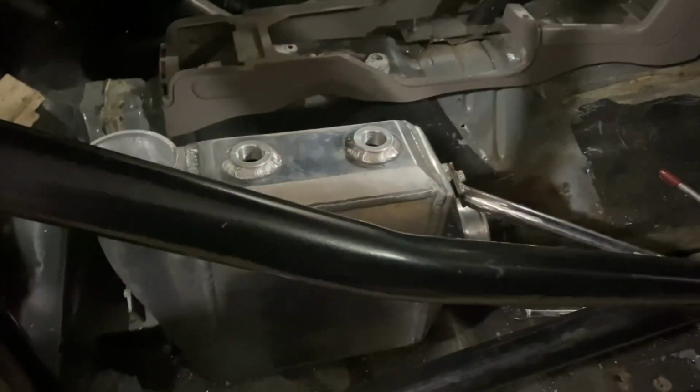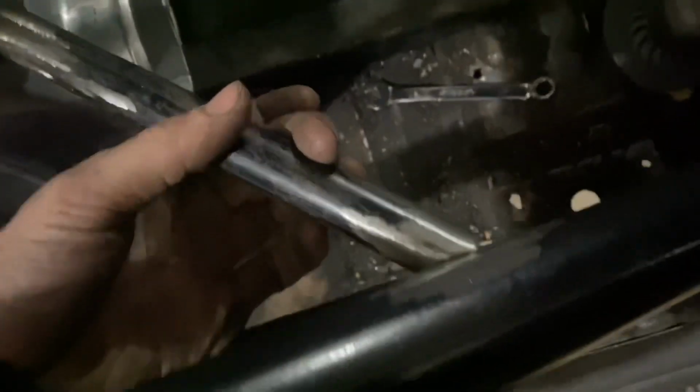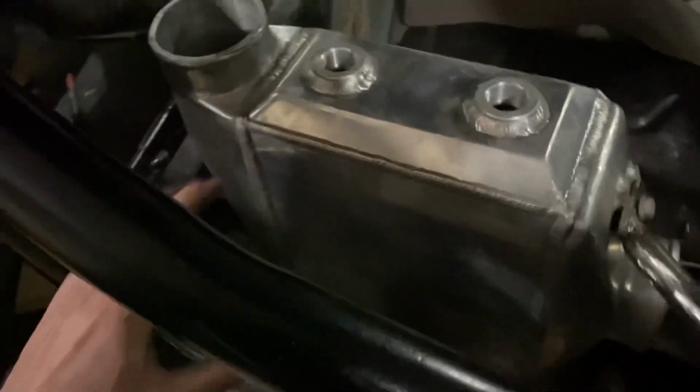So guys, I didn't give you an update in a while. Forgot all about it. So I ended up making the tabs. I got one here, just welded on. One down there. So I actually went from the tab here to the subframe connector. Basically I get this piece of pipe here now. You see I got it fitted on the cage there pretty good. So I'm actually going to weld it to the cage, and the same as the one back here. But I haven't made this piece of pipe yet. I'm just going to go from here to here. Basically it will be very triangulated.